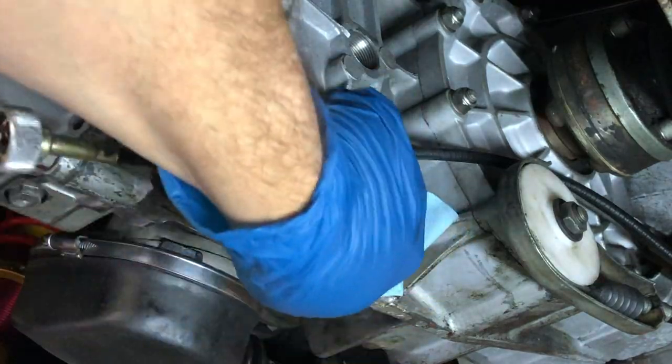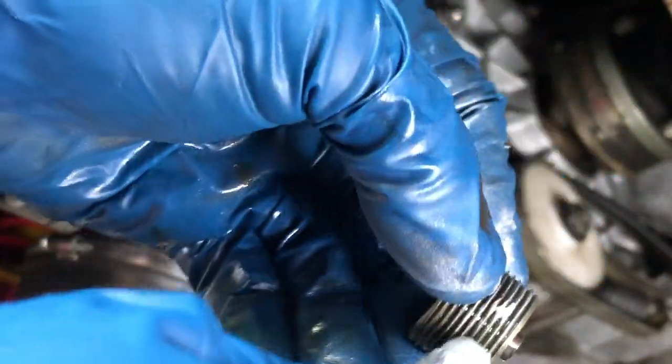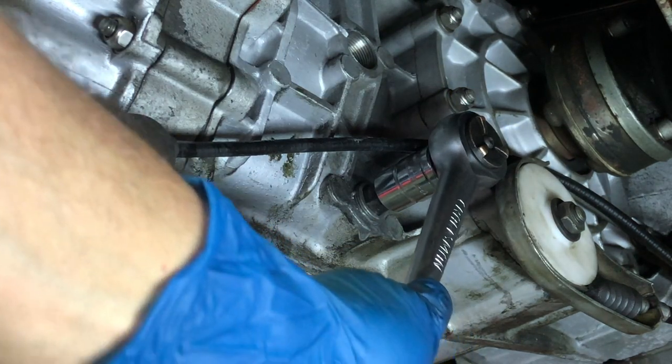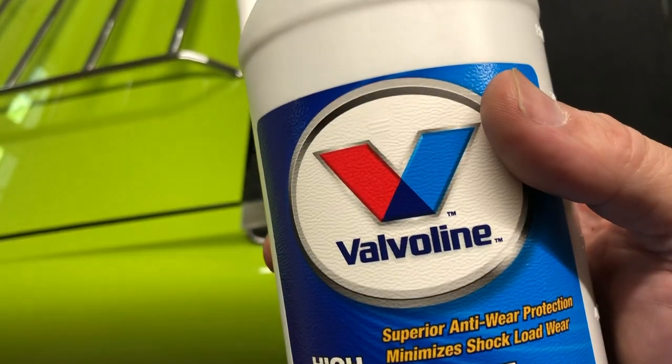Now that the speedometer gear drive is in, let's replace the drain plug and fill the case. Make sure it's nice and clean — I won my fight with the magnet so it's clean now. Put a little anti-seize on it to make it easier to remove next time, then put it back in the case. Torque spec is 13 to 17 foot-pounds. There are a lot of opinions about which gear oil is best, but I follow Dr. Evil's recommendation — he's probably the best rebuilder of 901 transmissions out there, and he likes good old 90-weight dinosaur oil. Nothing fancy, no synthetics, just make sure it's GL5 rated with no slip additives. Sometimes the simplest and cheapest stuff is best, and that doesn't happen often with Porsches, so take advantage when you can.